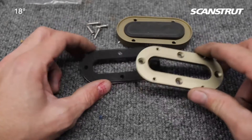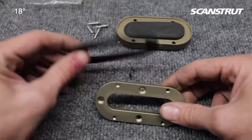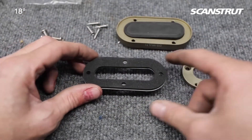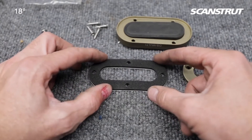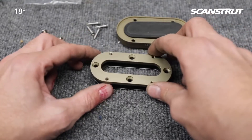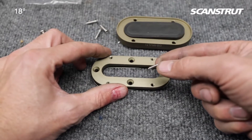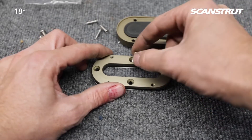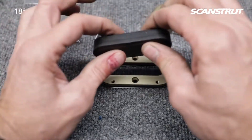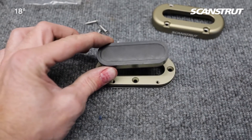What it looks like you do here is that this is the main gasket — 3M, that's nice. This goes on the exterior of the van, up on the roof, and this will stick down. Then we'll have to cut the sheet metal around this, and then this will be the base plate. Now they've got it running in with just these little stainless wood screws. You have the top piece, and there's this rubber — it's really dense. They said to freeze this and then drill the holes you want for your wires that are going to run through.